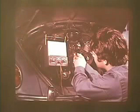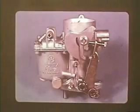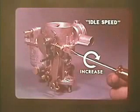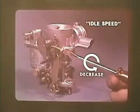It's this combination — correct idle RPM and correct mixture — that keeps the engine running efficiently, not too fast or slow, or too rich or lean. And here's where you come in. Let's talk first about idle speed. Turning the idle speed adjusting screw to the right opens the throttle valve and increases the engine speed. Turning it to the left closes the throttle valve, reducing the speed.